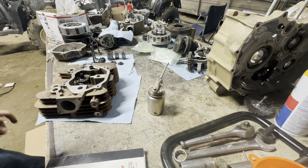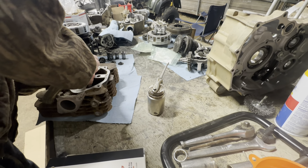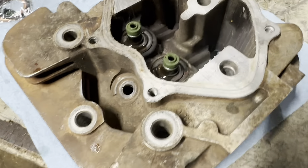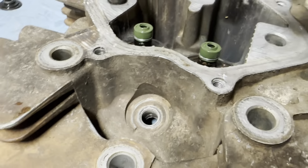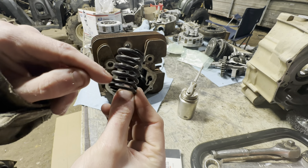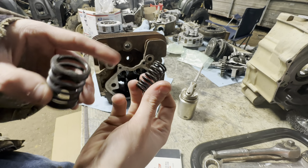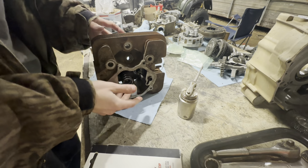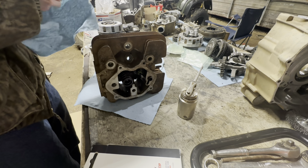I have like everything on the table here, so just don't mind that. I need to put a little bit more oil on the side — there, I got her. So your spring kind of stays on the bottom there, make sure it's flush. On your springs, they'll be tightly wound — you can see right there at the bottom they're wound just a little bit tighter. That tightly wound end faces down. I don't really think it matters that much, but if you read the service manual, you'll see what I'm talking about — they specifically say that.